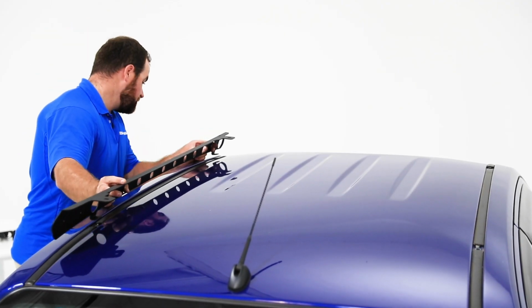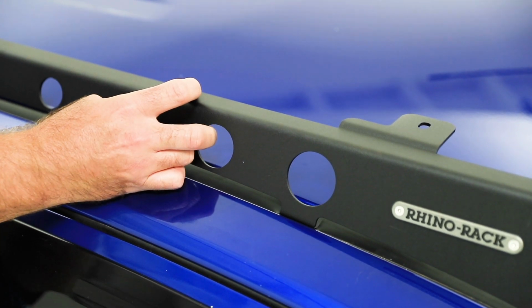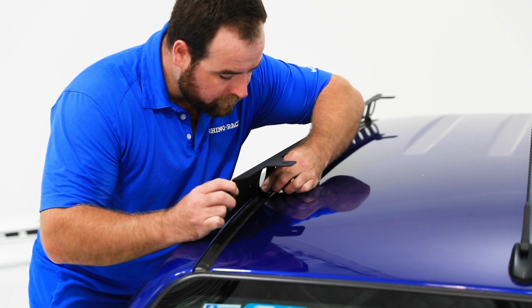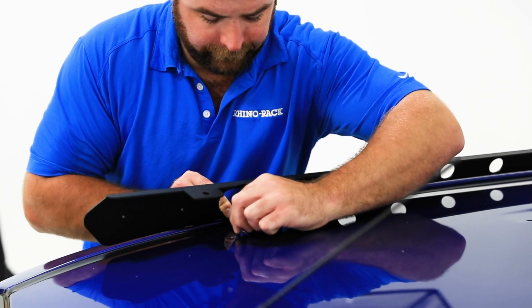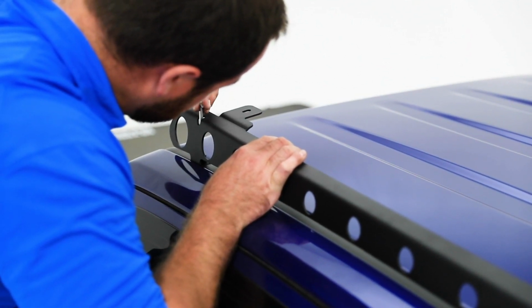Now place the backbone onto the vehicle. Be sure that they are in the correct orientation. Start by finger tightening the backbone in place with M8 socket head screws, which should have the M8 spring and flat washer applied. Tighten with an Allen key. The hardware can be accessed easily from the outside of the vehicle.